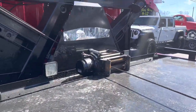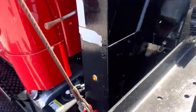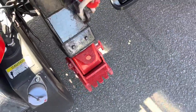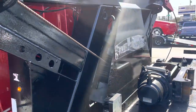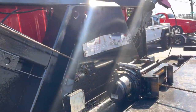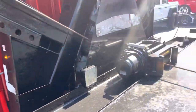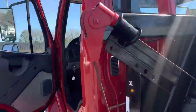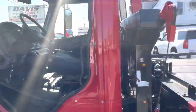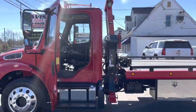The winch works — this is a double winch system for the side puller. It engages the stiff legs, and the stiff legs work properly. The air shift for the winch works properly, but we just do not have a controller. The manufacturer says there's a manual way to control them, but this one was obviously set up for a wireless winch remote, so we're checking on that. Overall a nice truck — if you've got any questions, give us a call.